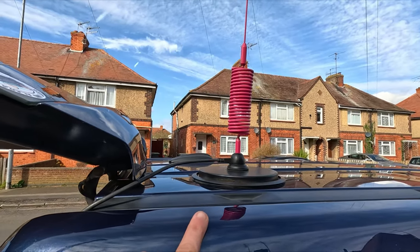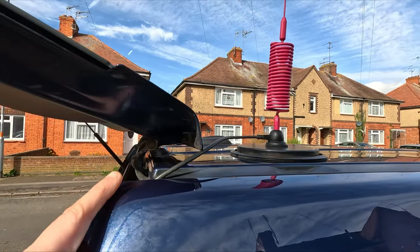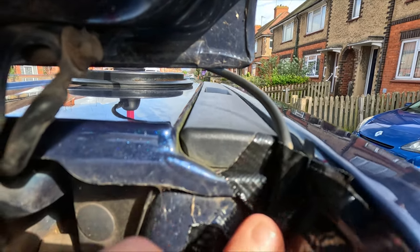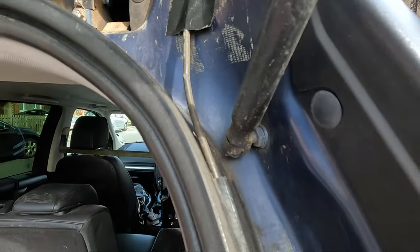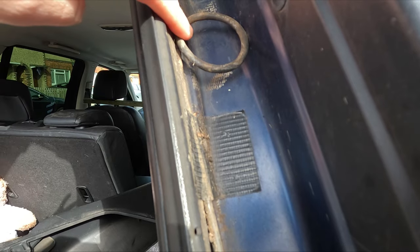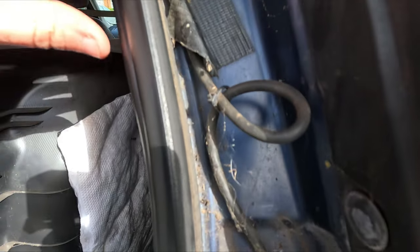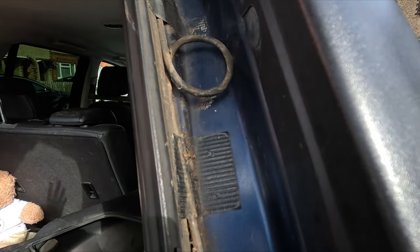Once you've decided where you want to mount your aerial — ours is on the driver's side — you can trace the wire all the way down. It should sit in this little recess just here, all the way down. We've got a drip loop just here, and then one just here, and there's also one down just here. Those are there to stop any water following the wire all the way down, so it drips off and you don't get water in your boot.